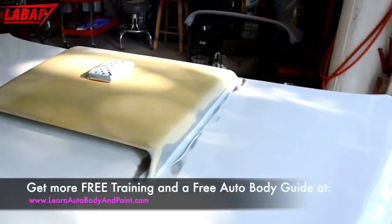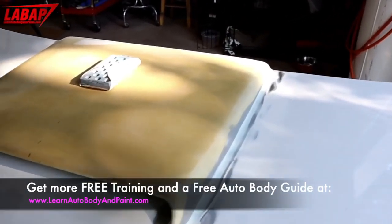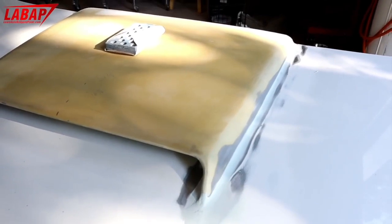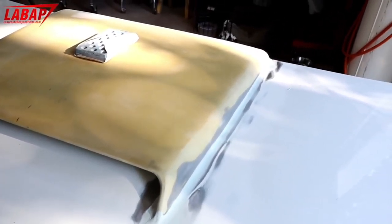Now, when doing custom work like this, you're going to go over with Bondo at least 4 passes, sometimes 6, sometimes up to 8 passes, because you're trying to get the shape right. All right, so if we look in here, you can see it needs a little bit of filler in those dark areas there. You see it? A little low area in there. So I still need to put some filler in here.